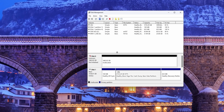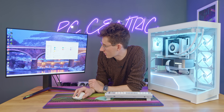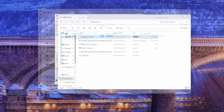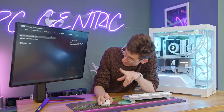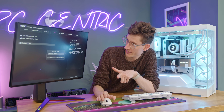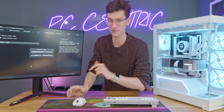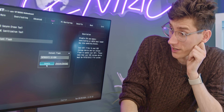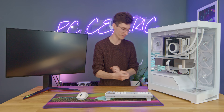To fix the FAT32 issue: search for Disk Management, scroll down to find your USB flash drive — here you can see it's in exFAT. However, there's also a Windows 11 partition on the drive that is formatted as FAT32, so I can just copy the ROM file there instead. Here's our USB flash drive, here's our ROM — I'll copy it across to that FAT32 partition, restart, go back to Tool > Instant Flash, and there it is: the file is now detected. That was 100% deliberate to show you how to handle a non-FAT32 situation.